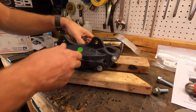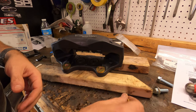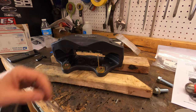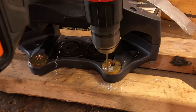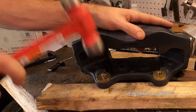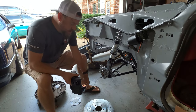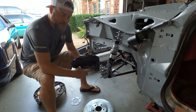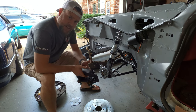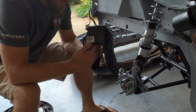I'm going to use this drill bit and drill through all the way through the caliper so we can put in the insert — that way the insert doesn't spin. You drill all the way through so you can hammer it out from the backside if needed. Now, besides the difference in width of the ears on the Cadillac caliper versus an SN95 spindle, another difference is the offset — what actually centers the rotor perfectly in your caliper.